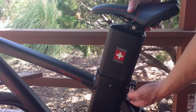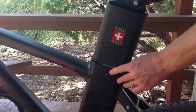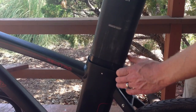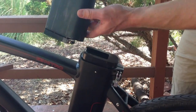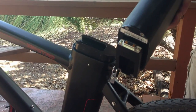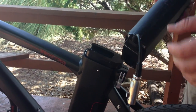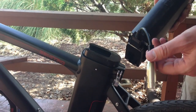To take the battery pack out, you want to undo the seat post quick release, then pull up the battery pack until the connector locks into place. Close the quick release for the seat post, then from the back push the seat post forward and it will come off the bike. You'll see a little connector for charging — there's an adapter that comes with the bike. Connect one side to the battery pack and then the other side connects to the charger, which then connects to a normal wall outlet.